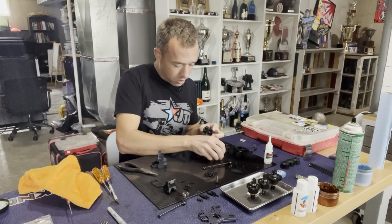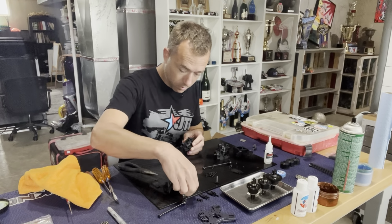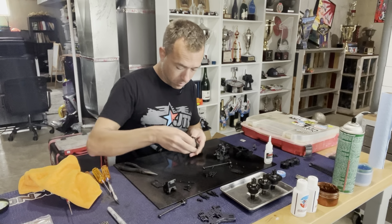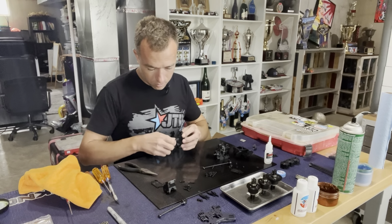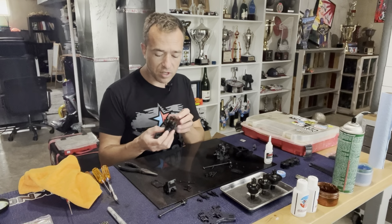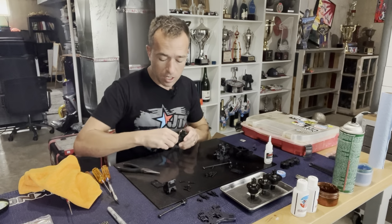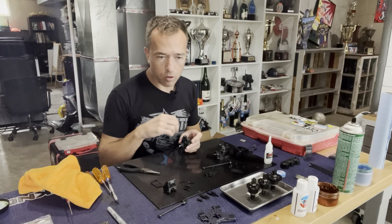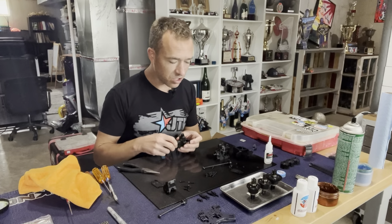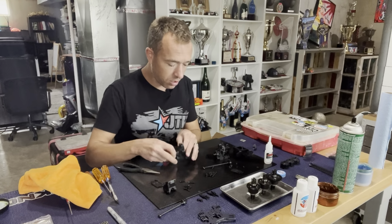Let's go ahead and start putting these bearings in. Put the pinions in. Sometimes the bearings will go in a little bit cockeyed, and when you go to push your pinion in, it'll go through one bearing good, but the next bearing gets stuck. If that happens, pop the bearings back out, put them back in, maybe even put the inner bearing on the pinion and try to get it to go in really flat. If you still have some issues, once you put it in, you can try to move it around and just get the bearings seated good. These both set in really nicely.